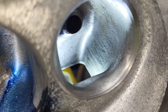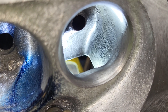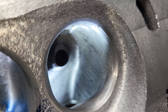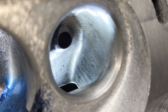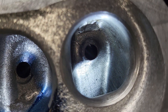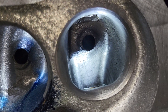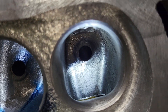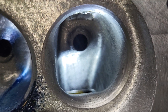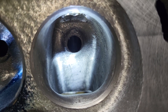You can see the exhaust — very thin valve seat, going into a radius right into the floor. That floor is very abrupt right out, so you can't do a nice deep Venturi into it like I would like. That makes it lose some efficiency. But we did get a decent step up. It's not completely polished — some metal was taken out to remove some paste ooze lines. There's still a little garbage around the guide, but we did get a nice step up. As of right now, this casting is straight cast iron from the valve face into the bowl about a half inch — it's solid. A lot of heads aren't that thick.